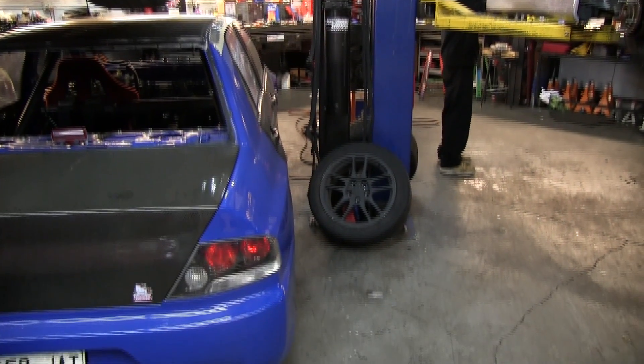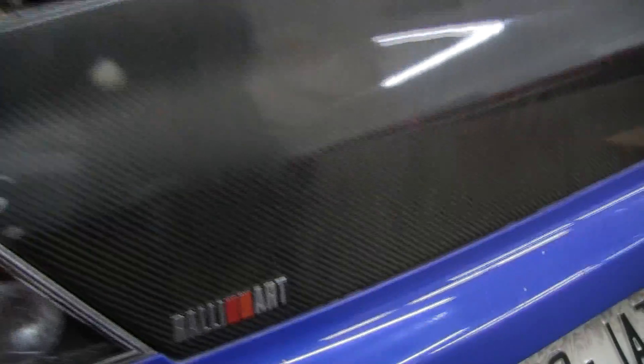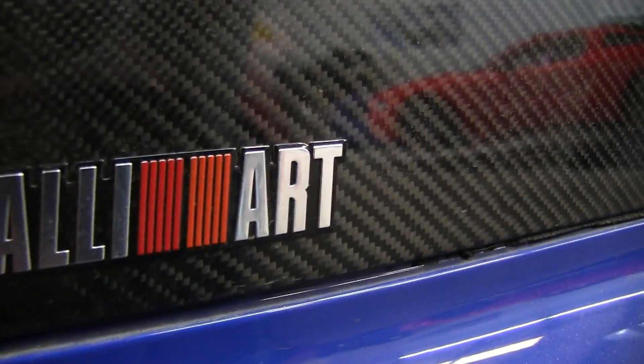If you own an STI and it's got 300 horsepower out of the box, what can you take it up to just by retuning it? Retuning and a tiny few mods usually gains about 40 to 60 horsepower to the wheels, which is pretty noticeable — and that's without any hardware. Basically a tune going into the computer, changing the way the car is set up from the factory, making it run more efficiently, turning up the boost a little, turning off some lean spool settings — things like that really pick up the car quite a bit.